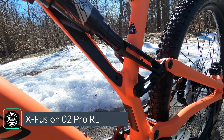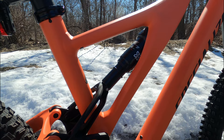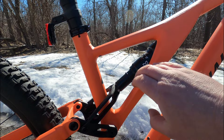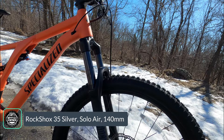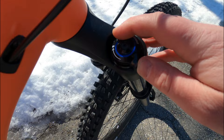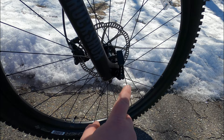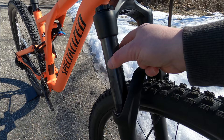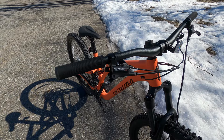To control the suspension, you've got the X-Fusion O2 Pro RL — a 190mm by 42.5mm rear shock mounting to the clevis and frame on standard eyelets, so it's a metric shock you can swap out as you upgrade. Up front, the 140mm travel is handled by the RockShox 35 Silver, which uses a turnkey lockout damper with open progressive notches all the way to locked out. On the same side is a rebound adjust to speed it up or slow it down. It's boost through axle — 15 by 110 — with 35mm Diffusion Black stanchions and air-adjustable spring under the top cap.